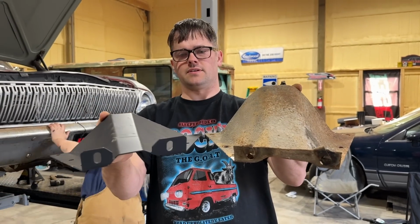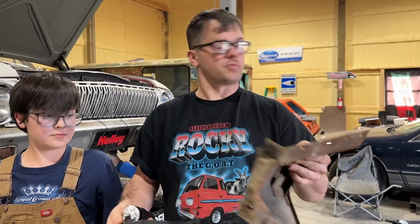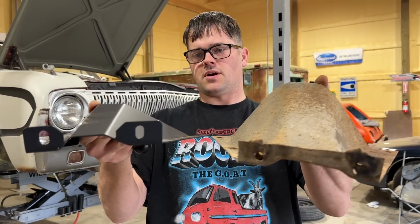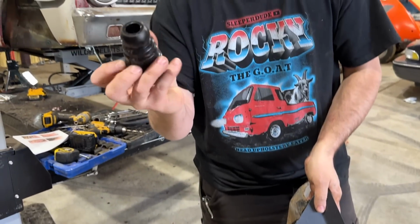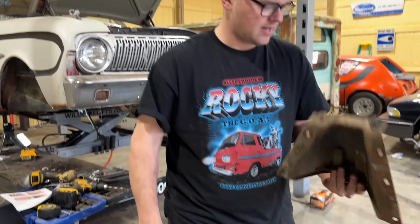Do you see the difference there? Yes. Because this, I guess, needed more space because of that big coil spring, but our new coilovers are narrower. So this allows you to run a wider hoop in there. And it upgrades your bump stop to a progressive bump stop that gets harder as it goes down instead of just a solid one. All kinds of cool stuff.